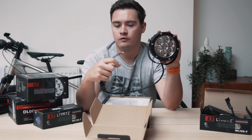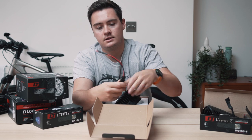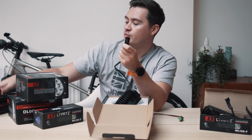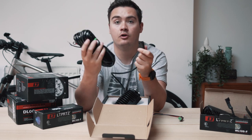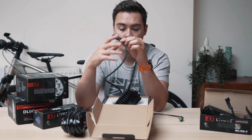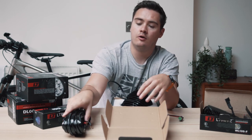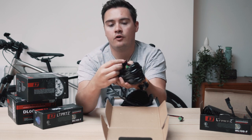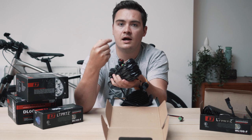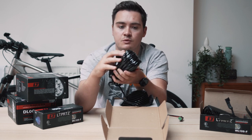So you've either got the one for your independent wiring, or if I just disconnect this, we have the connection point, which will basically plug and play into the loom that you can also get from ORE. So they'll just plug in. What I'm going to have to do obviously is connect all four up together, plug them into the loom, and then in the loom we have a switch for on off, which I'm going to change to a genuine switch, which will come through the dash, and I've got a blanking switch at the moment. I'll replace that with a switch for the spots.